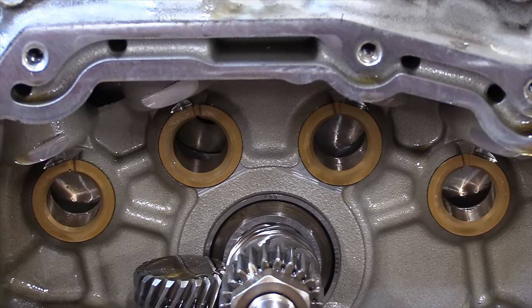Right, okay, another fabulous day of discovery, discovering that my engine is superb inside. No galling or scuffing on all the bushings here, they're absolutely like new. And they normally are, unless you've blown the engine up or run it out of oil, so fabulous. It's always said that these engines take 10,000 miles to fully run in, and it is true. As you can see, cross-hatching still inside the cylinder bores, and all of these bushings, the cams, the cam lobes, just a nice little polish to them, exactly as it should be. I'm really happy with that.